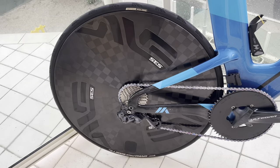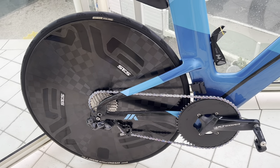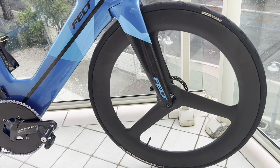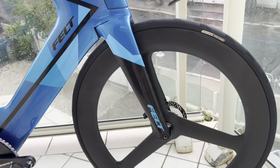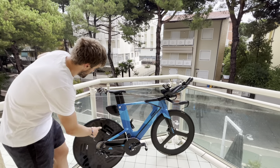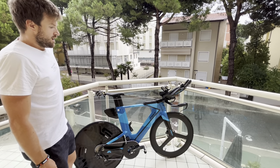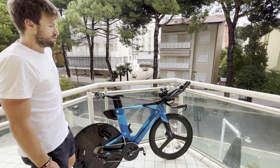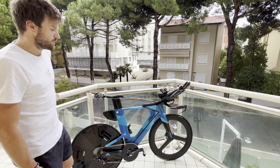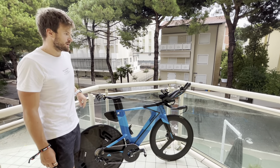Finally, wheels. I've got the Envy disc at the rear, and then on the front I've got an unbranded tri-spoke. Both of them are running tubeless with GP5000 TTs — the special edition Tour de France ones from last year, so they were left over. I'll probably run the front wheel at about 87-88 psi and the back wheel about 82, depending on whether it's dry. I might drop that down if it's going to be a little bit wet.